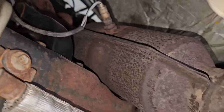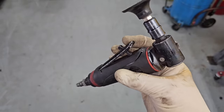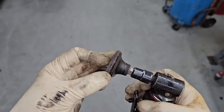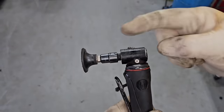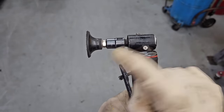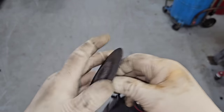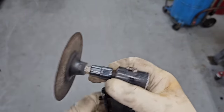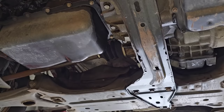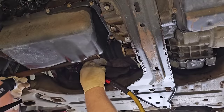Now I've got to figure out how to get those bolts out — the O2 is going to pop out. I don't think I can even film this. Let me show you something real quick: this is an angle grinder and you can put these little cut-off pads on it. Because I don't have a straight cutter — they make a cutting tool that goes straight so you can get into tighter spots — what I usually do is take a cut-off wheel like this, put it in place and lock it in. Now I can actually cut like this. You can't absolutely load into it because it'll start to spin, but to cut certain things off, yeah, it works perfectly.